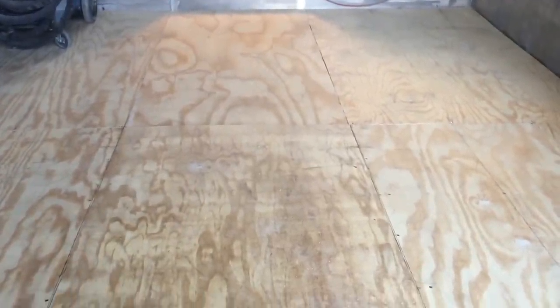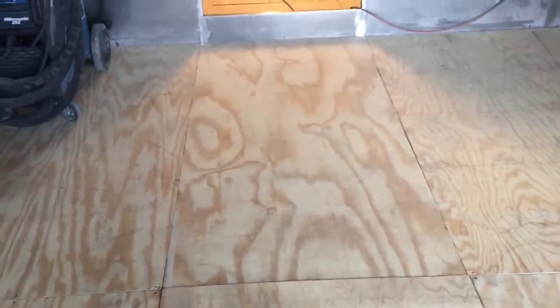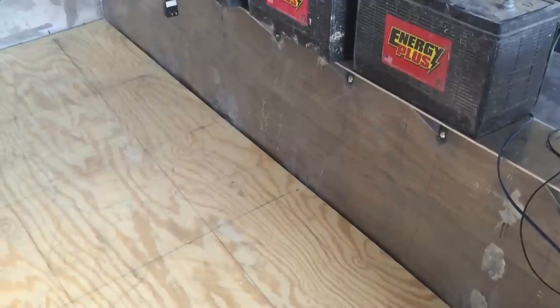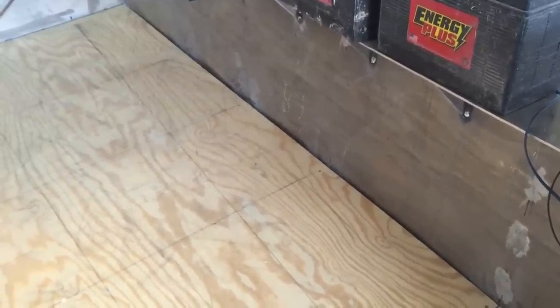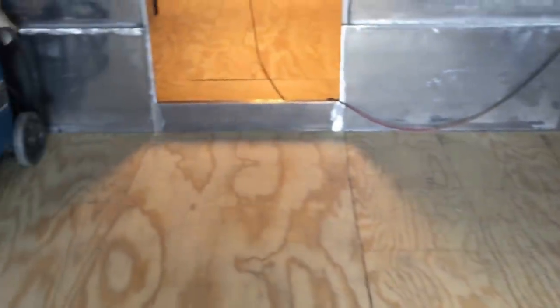This sheet, that sheet, and that sheet — plus a little corner piece — are all screwed down permanently, but these two sheets in the middle are not, so I can get in there. That may be why it looks like it's sticking up a little bit. Pretty happy with how the cut and fit went. There are a little bit of gaps on the sides — quarter inch to half inch in some places — but can't do a whole lot about that since the side of the boat is curved in that area. It's kind of temporary so I didn't worry about getting a super tight fit.